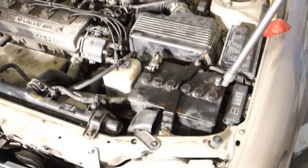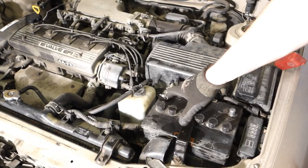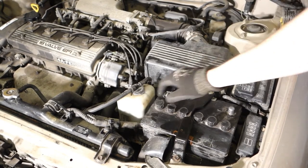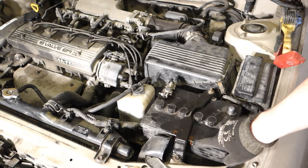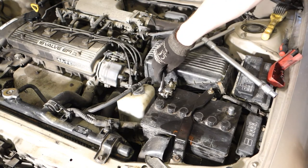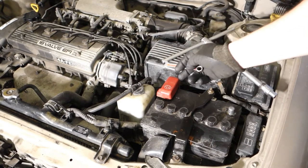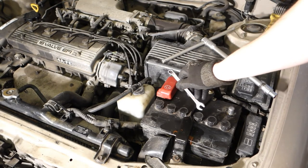And that means that I use only one hand and a small area in here. I don't fasten this too much, because if we fasten this battery too much, this cover is plastic and it can break. But most important is that when we try to move the battery, it must be so tight and fastened that it doesn't move. And now look, these metallic sides are just in here and also in here. And then I need to fasten this plus a little bit. Yes, plus is okay. And then there is this plus corrosion cover and protective cover. This is really important, because we always have to protect this area so that we don't get any corrosion.